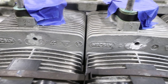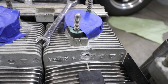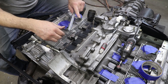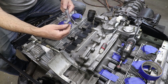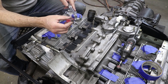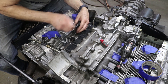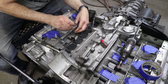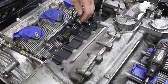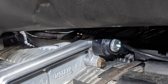I just touched those stampings — felt like I was defacing Porsche property — but I'm just trying to get a better connection to the heads with the bridge. I think we're ready to install it now for good. I've already checked that these bolts are the right length and installed them without lock washers to make sure they don't bottom out prematurely — they're fine the way they are. I'm just going to put a little bit of blue Loctite on each of them. That's probably five foot pounds — we just want to make sure that lock washer is compressed and that they're all even. I'm going to leave this loose because I'm not sure what direction I want the wire to exit — probably towards the front of the car — but we'll tighten that later.